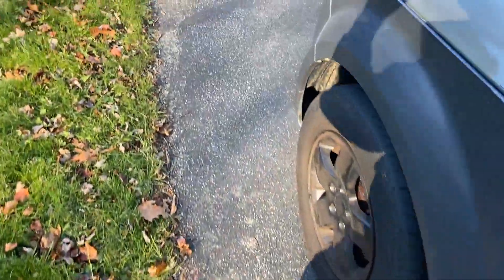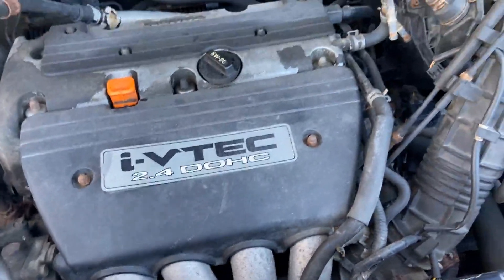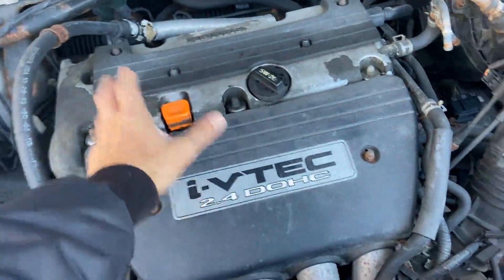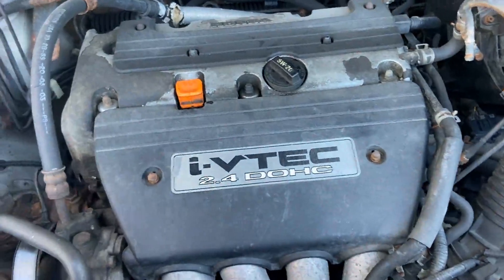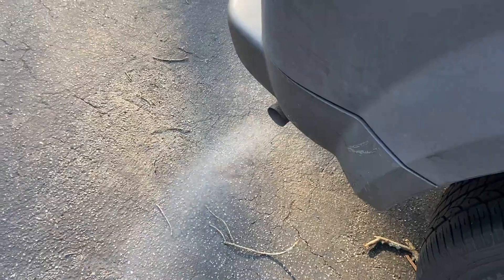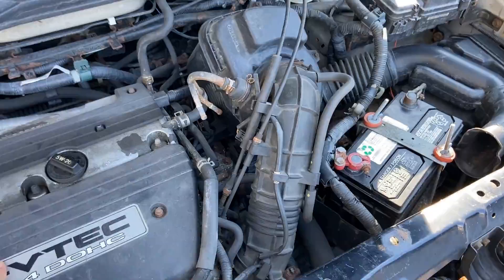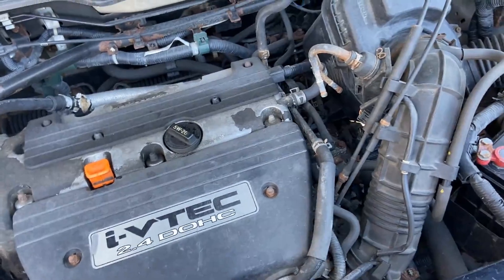What tipped me off is I was losing engine coolant without any visible leak, and then I had a misfire. The engine light went on, and then moments later the car actually shut off by itself. I looked at the oil and it looks good — needs to be changed, but it's not milky or frothy. There was also more white smoke coming out of the exhaust — it looked whiter than I think it should.